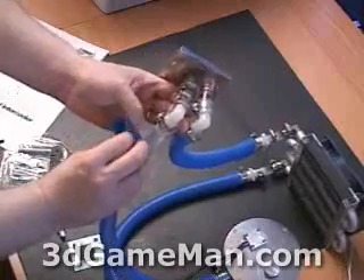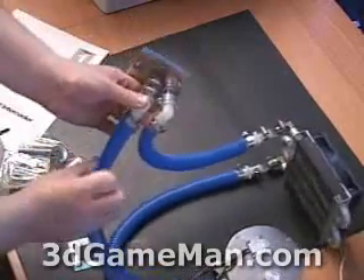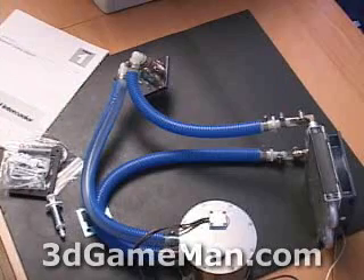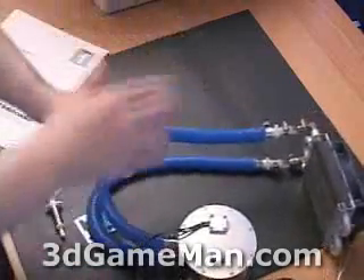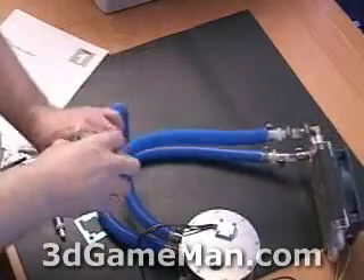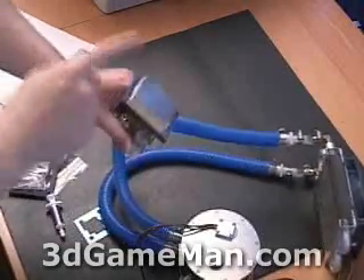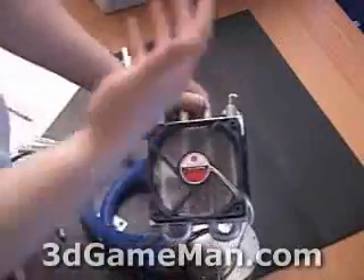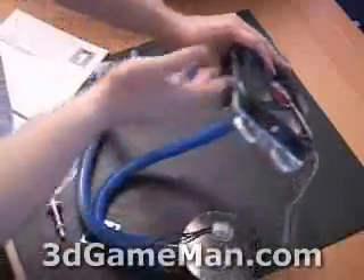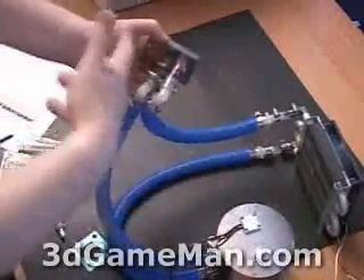Something included in this setup is protective plastic around the tubes, which is great because it helps against sharp edges that may be inside your case. Now, how does a water cooling kit keep your CPU cool? The water block is mounted on top of your CPU. When the system is on, the CPU heats up, which heats the water block and the water above it. That hot water gets pumped into the radiator, which disperses the heat assisted by the fan. The cooled water then returns to the reservoir, and the pump cycles it back to the block as cold water — and the cycle continues.